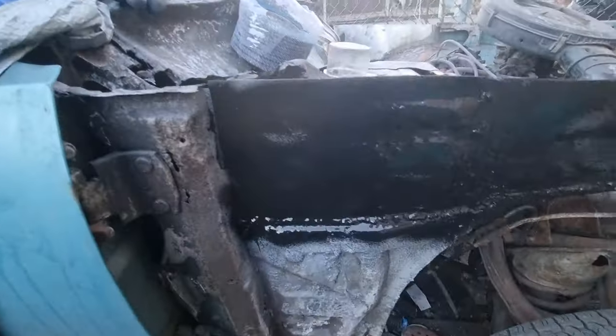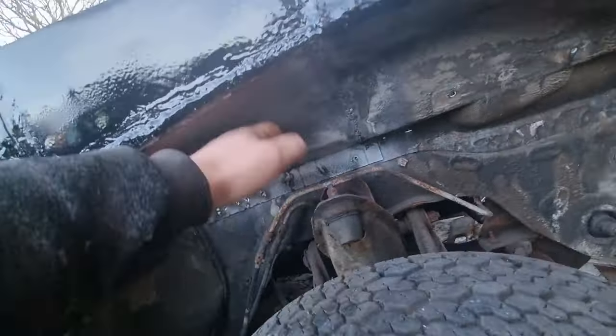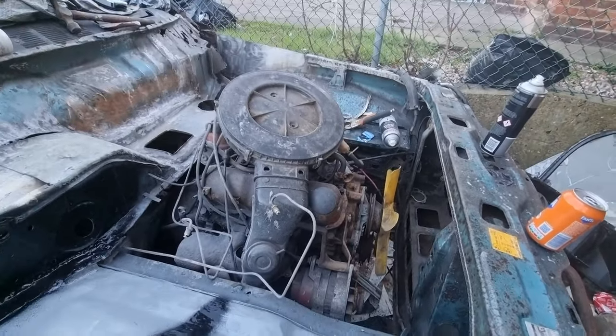That came out beautiful. My welds — if you look at them under your finger — they are massive all the way across. I managed to get a bead all the way across, spot welded all the way across there. That side is done. Obviously I've got to grind a bit off the top here for when I weld the inner wing tops back in. I am so tired now. No holes under there — the tubs are actually repaired. These are all repaired and ready to be stone chipped, just a bit of cleaning up here and over there.